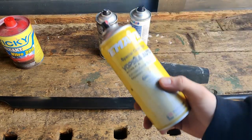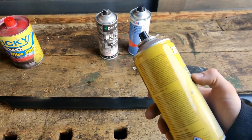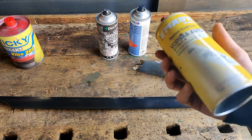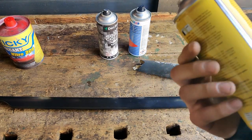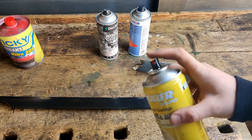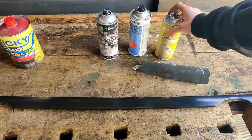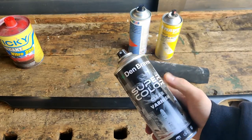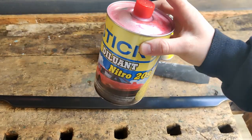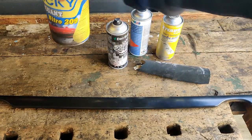After that, I have color matching spray can paint for my car, which is the Volkswagen Tornado Red. This was also around $8 to $10. A really good paint. I painted my front bumper with this technique and it came out really good. After that, a glossy clear coat finish and a degreaser before you start the primer. And that's kind of it.